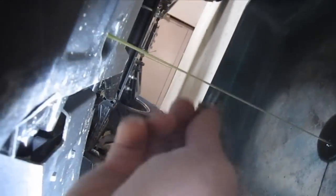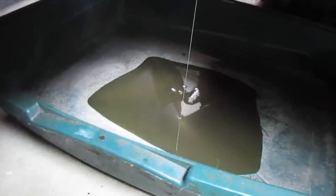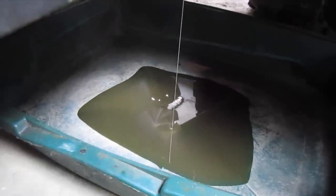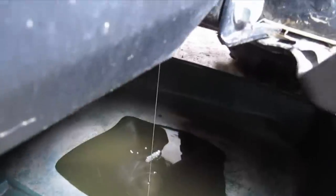When you change your differential fluid, you may see that there are some silver flakes in it. That's normal — that's the clutch material, not necessarily gear material. If you use your locking differential quite a bit, or if you were doing some plowing like I've been doing, you may have worn the clutch. I'll run through how to adjust that front locking differential lever in another video. Mine doesn't look too bad. You can see some silver sheen to the oil right where it's hitting the puddle — that's normal. You just don't want any big chunks of filings.